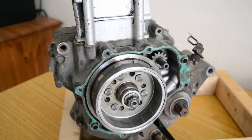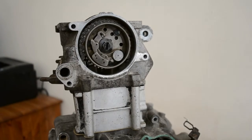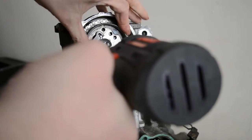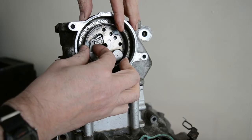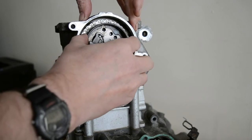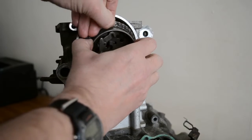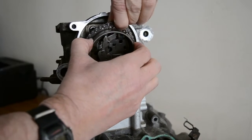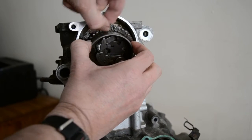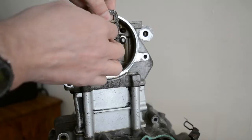You can then remove the top off — just going to do that now with a 12mm nut. Make sure you make note of your decompressor, but it's pretty easy to put back anyway. Just pull it free, try and loosen the chain a bit — it's on there pretty tight and doesn't give you much room. There's your gear off with your decompression weight.